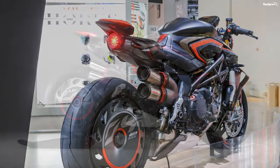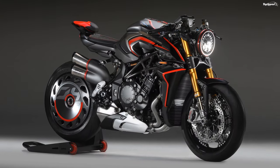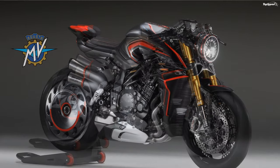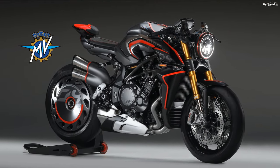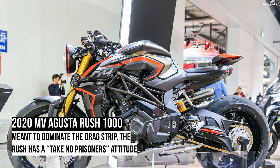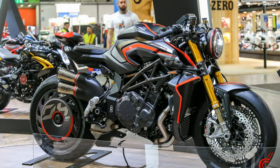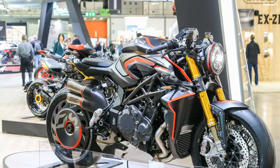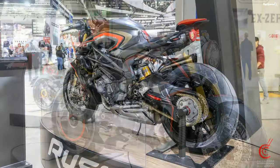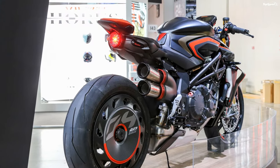The brake hardware comes from Brembo, with dual 320mm discs and 4-piston calipers to slow the front wheel for the bulk of the braking power, and a 220mm disc and twin-pot binder to control the rear. ABS protection comes from the Bosch 9 Plus anti-lock system that delivers a race mode along with a rear wheel lift-up mitigation feature that keeps the rear end down under heavy braking actions to bolster the safety electronics yet again.